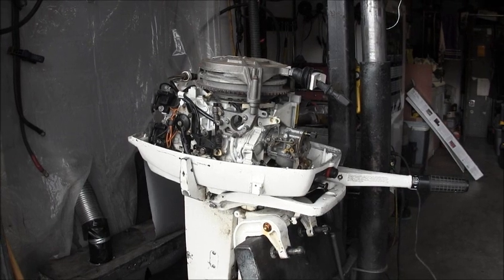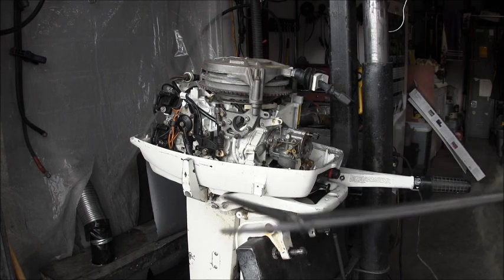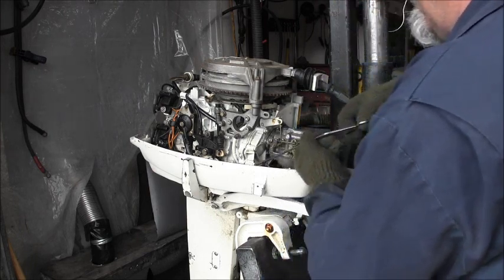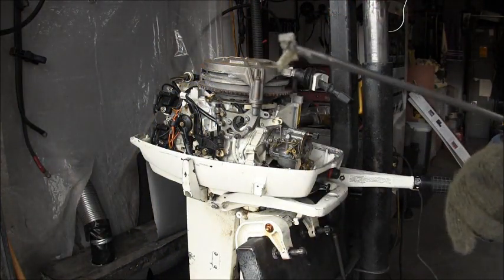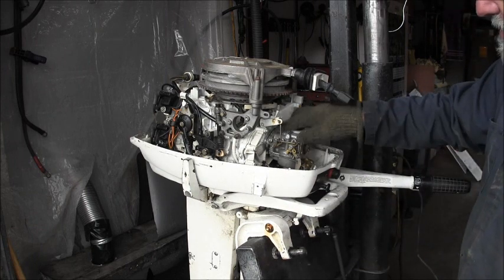Okay, we got some pretty transom clamps on there now. Now the guy didn't say much of anything else in the note he sent in from the bush. He basically just said put on transom clamps, but I got to looking around. I saw boogers and ugly things in there. This is from the foam on the engine bonnet. There's a whole bunch, I mean, it's everywhere. Think I'm kidding? Everywhere in there. All over. That carburetor had been sucking it in for a while.